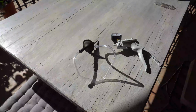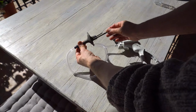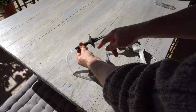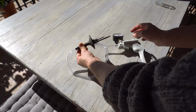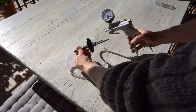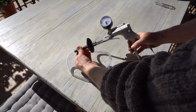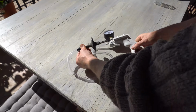I want to talk about the vacuum advance, which I've taken off my TR3A. As you can see, it's on the bench here, and we've got this spring, and in here there's a diaphragm. You can just put this tube on and suck, and what should happen is the spring should move back and stay back, and then you know the diaphragm's okay. But if you do this with this vacuum tool that I've got, you can actually see it moving straight back down to zero. Now what I'll do is I'll take this across and actually put it on the car and show you what actually happens on the new unit.